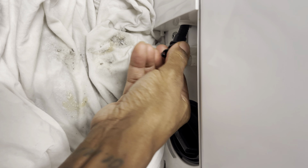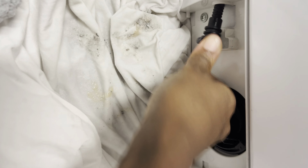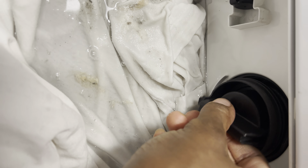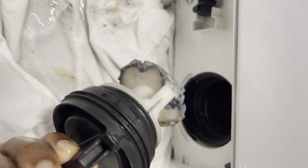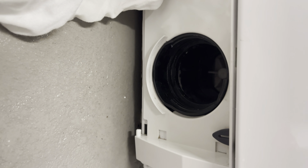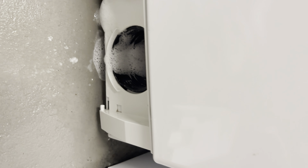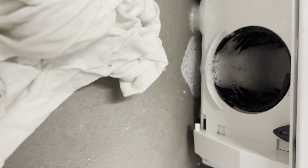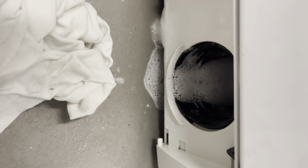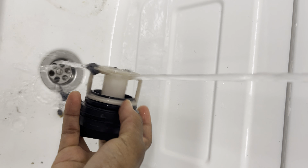The fifth step is where you remove the filter cover. You have an emergency drain tube — just pull it out and drain it, and you can see how dirty the water is. Then you have the main filter where debris collects. I give this a good spray and leave that to work whilst I take the filter and rinse it under water.